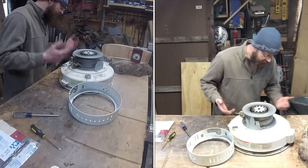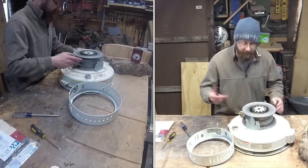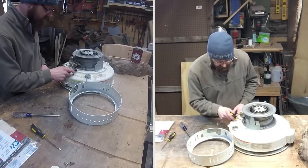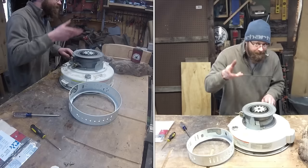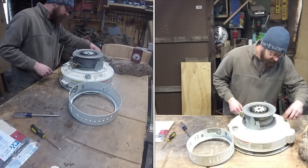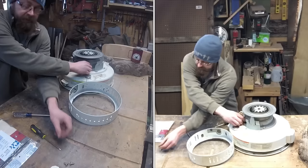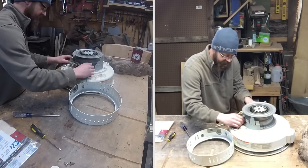On the model I have there are four wing nuts — you might have two or three. The first time I did this the wing nuts were pretty tight, so I used a flat screwdriver, figured out which way they go — counterclockwise to loosen — then came back and used my hands to take them off. Don't lose them; set them aside with the other two screws from earlier.